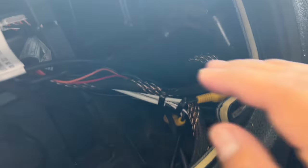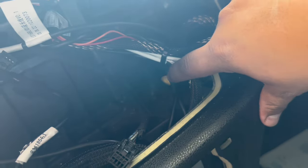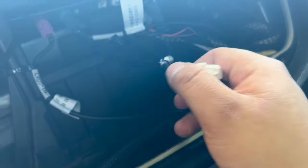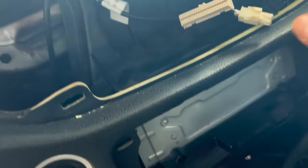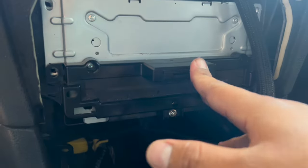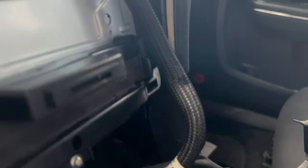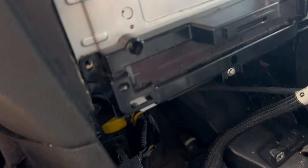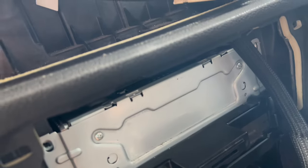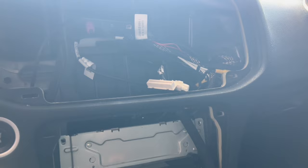Overall it's pretty good. The cables — just zip tie them together like this and route them in this hole right here, and then you have your three connections. This one, this one, and this one — that should close right up again. The receiver is inside too so that'll be fine. If you are installing the USB cable, I routed mine towards the bottom — it comes out over here. You can use that for CarPlay or I'm gonna use it for screen mirroring on trips.